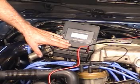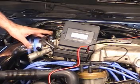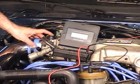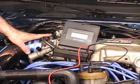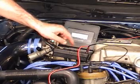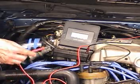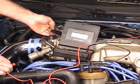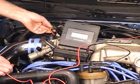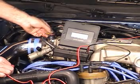I have the digital voltmeter in the engine bay here, close to the throttle position sensor. That's the first sensor I want to test. The first test I want to make is to verify that the signal return has a complete circuit in the sensor. I put the meter on the ohm scale, with one probe wire hooked to battery ground, and then I'll use the other probe wire to back probe the signal return wire on the hard shell. I pulled back the little weather connector here to make it a little bit easier to back probe these wires, and the signal return happens to be a black wire on this one.